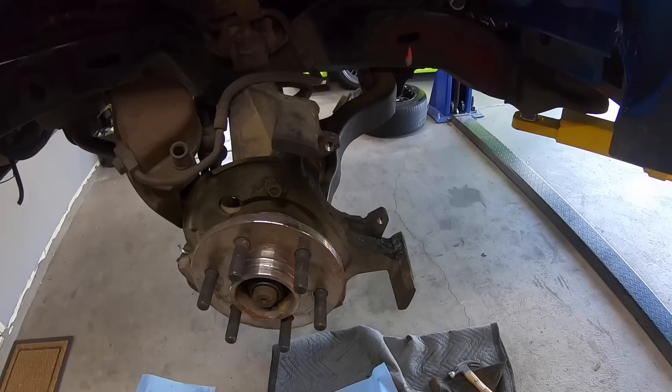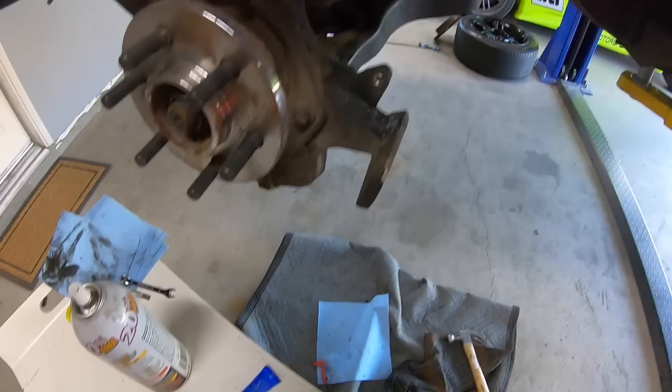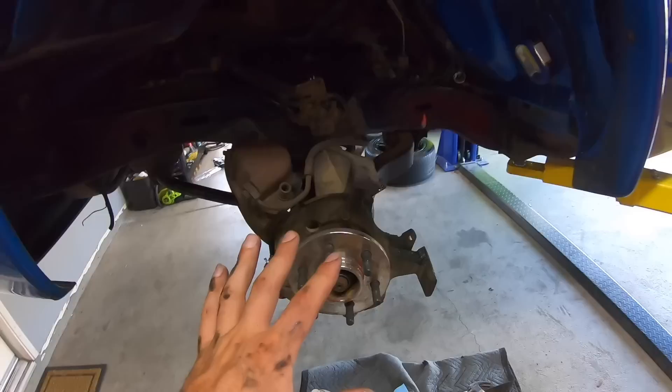Here's where we're at — we have threads. The threads are in here. We're just messing around with the helicoil kit. We drilled it, we tapped it, now we have threads. I'm gonna finish the passenger side and then we put these calipers and wheels back on.